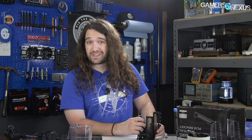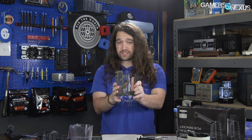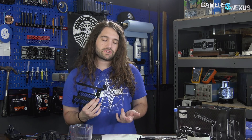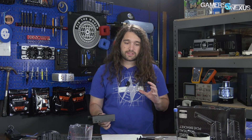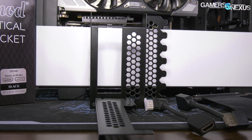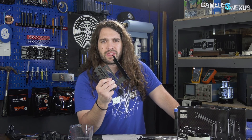This is CableMod's new vertical GPU mount. We showed it in our ad pre-roll during Computex, and now it's time to actually dig into it and see how it performs. We had some thoughts that it would actually do as it promises, because ultimately you're socketing this into the PCIe expansion slots and pushing back the GPU several inches — somewhere in the range of two to four inches, depending on the case. For our testing, we're using a Cooler Master H500M. It doesn't represent 100% of cases on the market, but it represents the majority of them, because all these cases with vertical mounts basically push the card right up against the glass, which is fine for open loop, but not for air. This mount pushes it closer to the motherboard.